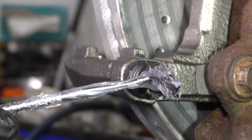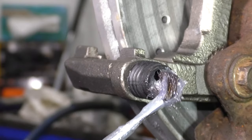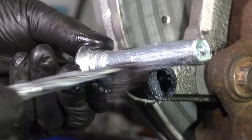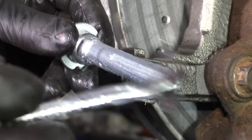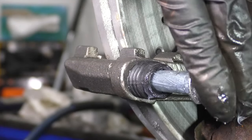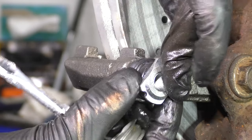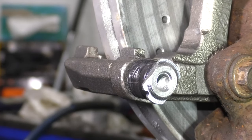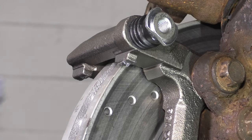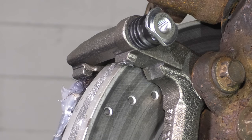Just like for the top, I'm going to add some silicone paste to the inside of the boot here. Keep in mind, I'm using high temperature brake-rated silicone paste. You want to make sure that whatever you're using — whether it's brake grease or silicone paste — can withstand high temperatures so that it doesn't melt and wash away as your brakes heat up, because they do get pretty hot. Slide this pin back in all the way. Give it a couple twists and squeeze any excess air or grease out.